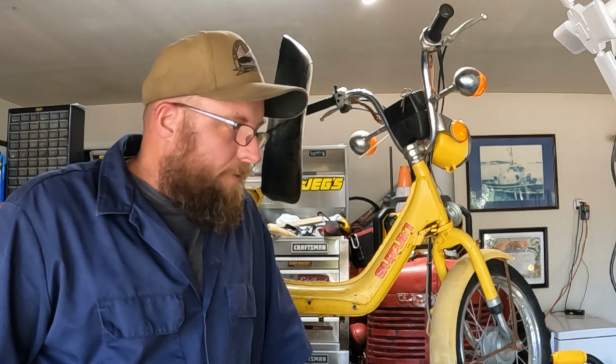right now. All right, folks, we're back here on the moped. I spent a few hours troubleshooting the electrical system. Ignition coil is good, magnetos are good, rectifier is good, the PEI, the electronic ignition is good. Everything tests out. I did ohm checks and all kinds of stuff.